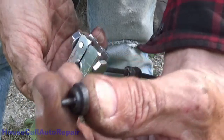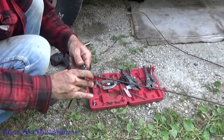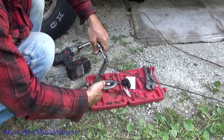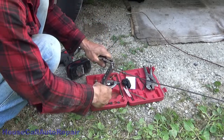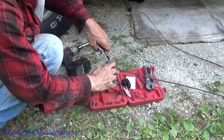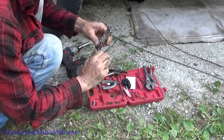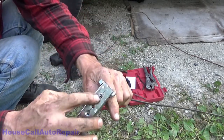Bring a line just enough sticking out through that it lines up with the very first step of your gauge, and then tighten it down really tight. Gotta loosen the other side a little bit to tighten it down. Let it slip, but I'll have to double check it. We're still where we need to be. Again, make sure that your chamfered end is the end that it's sticking out from.